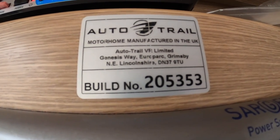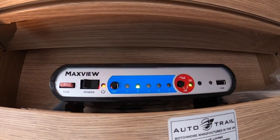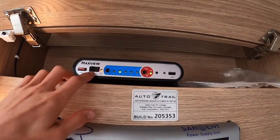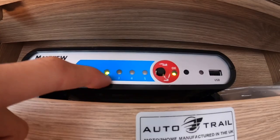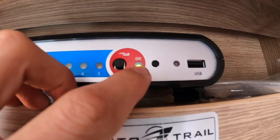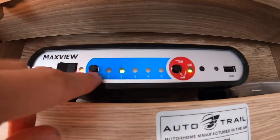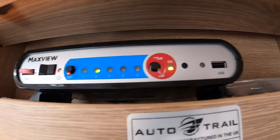You've got your build numbers — should you need any parts for the vehicle, quote this number and they'll know what part is required. This vehicle has been fitted with a MaxView satellite system — standard they just come with an aerial but this has got the sat system. Turn the power on to this switch, it'll then flash all the buttons until it starts flashing on two, and once the light goes to a solid light it's found Astra 2. To put the dish up, press here until it's found and it'll go solid when it's locked on to Astra 2. To change the satellite, press sat — should you be going further afield abroad, press this and it'll go one to five and find the sat system.